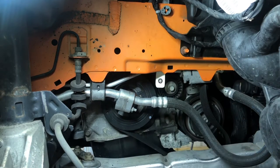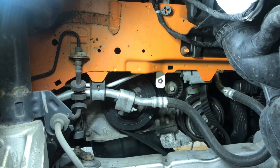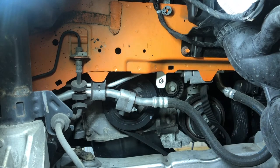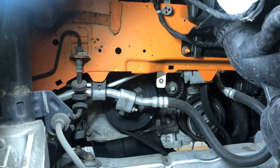And like I said, can't even see the wrench now. I'm leaving it on there, but I'll be able to get my finger up there and pull it. It's not a very hard tensioner. Some tensioners, you really got to use like a half inch bar to do. This one was very easy. So first step, battery. Second step, tire. Third step, shroud. Fourth step, put a 16 millimeter on that tensioner, turn it left, and then you can get that belt off. So next step is going to be working on the alternator. So let's get to it.